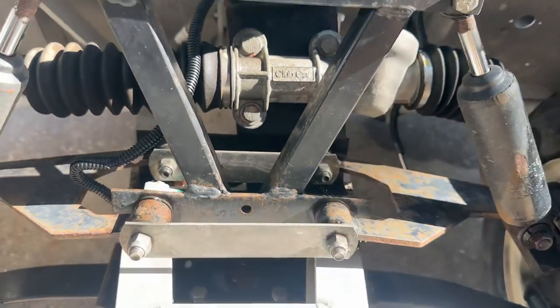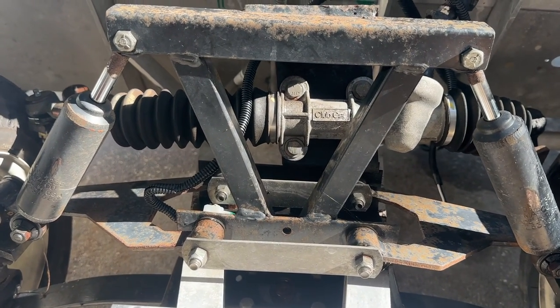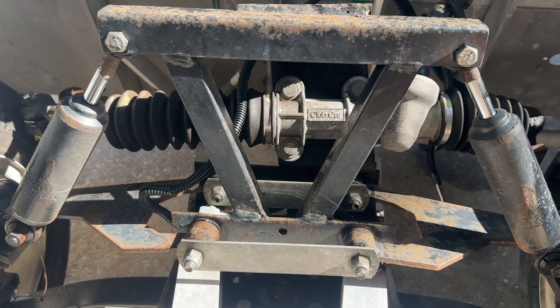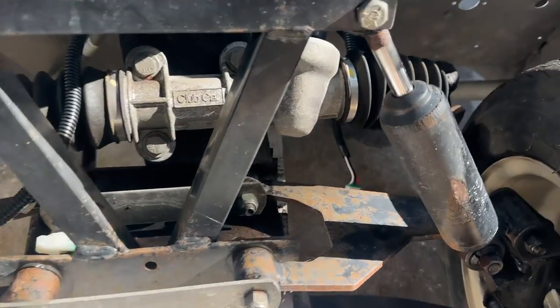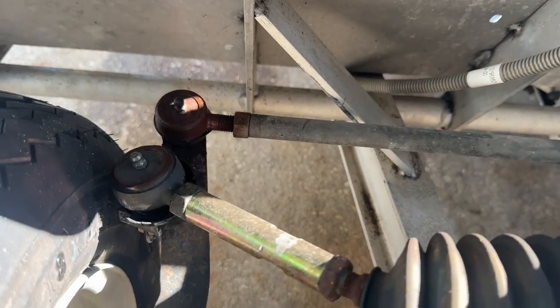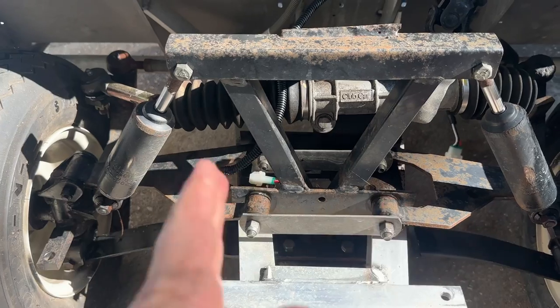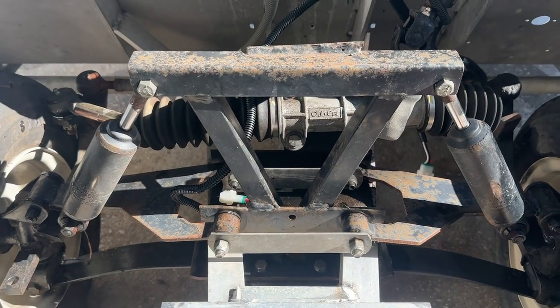This is an original 22-year-old gearbox. You can get an Amazon special — I'll throw a link down below — 50 to 60 bucks for a new rack and pinion, but that's where you'll want to start. All these little points of movement, as they start to age and wear, create a cumulative problem, and that's your side-to-side issue.